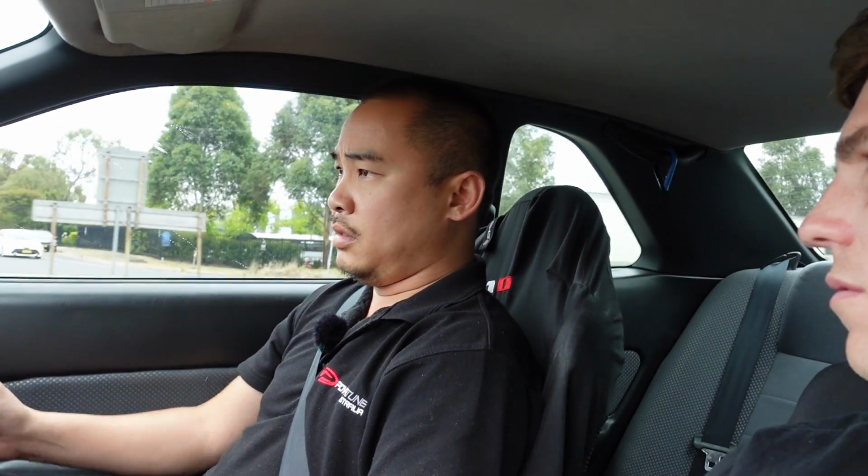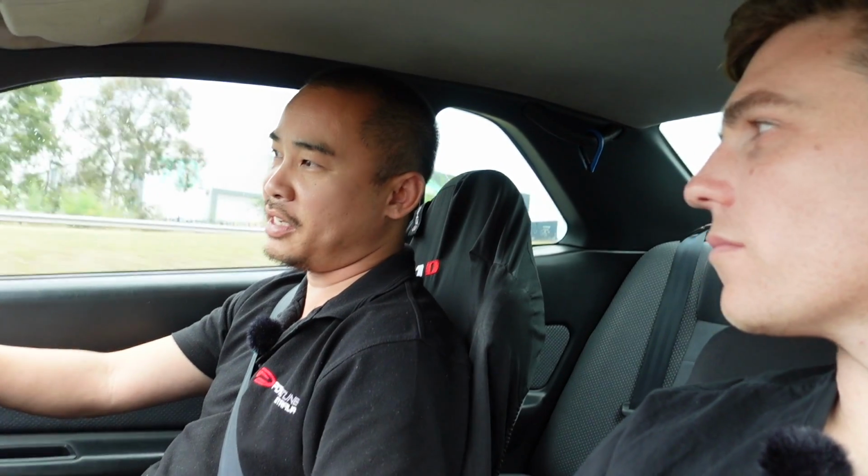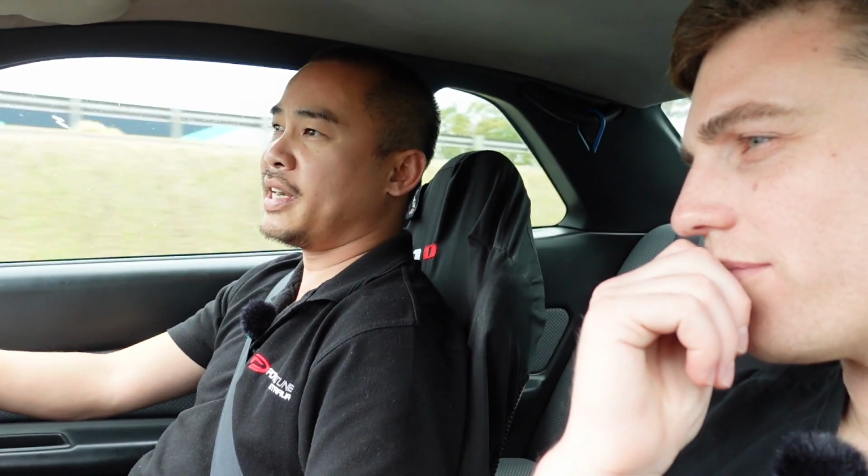So when you road tune these, do you factor in trying to get good fuel mileage? Yeah, because it runs in closed loop, the fueling's bang on anyway, as long as you try and minimise the fuel trim. But the ignition curve is where you'll actually get a lot of efficiency. A lot of times you just run the car up on the dyno and map the wide open throttle bit. You're not really tuning this area here, and getting the ignition curve correct for the setup. That's where you get the engine to be the most efficient.